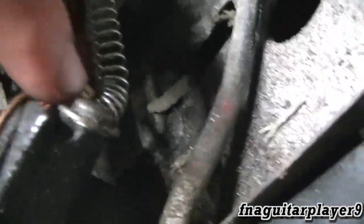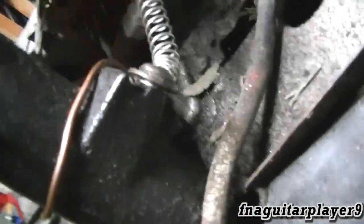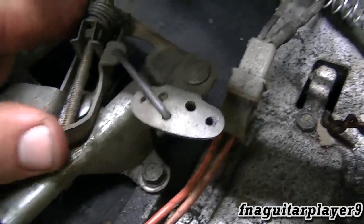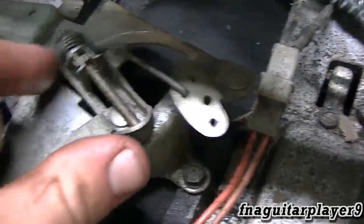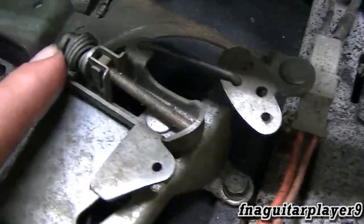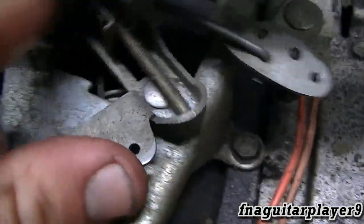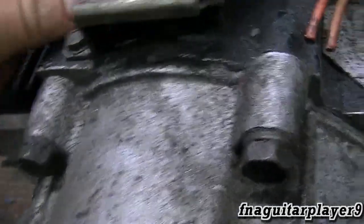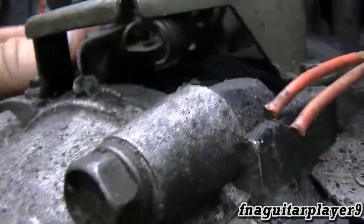I've got an angle going to this screw here where your throttle cable would go, and it would run down here and hook to this hole right here — it would pull it up like that. This adjustment here on this bolt adjusts the tension on your governor spring, which you can see right there — it runs down and hooks under that arm right here.